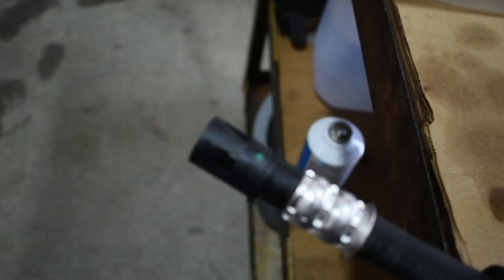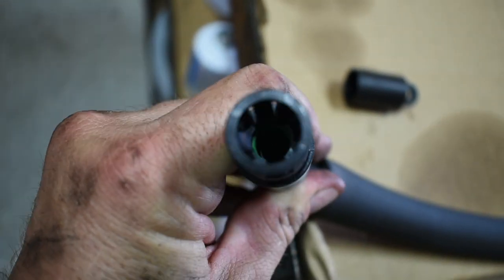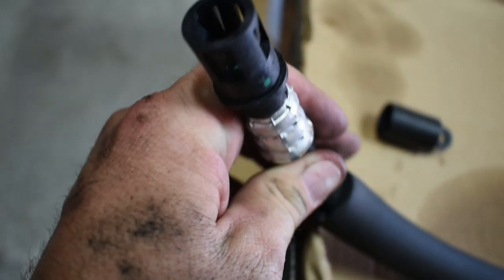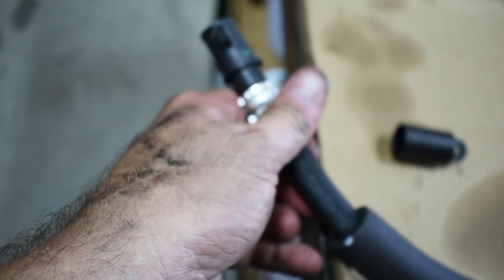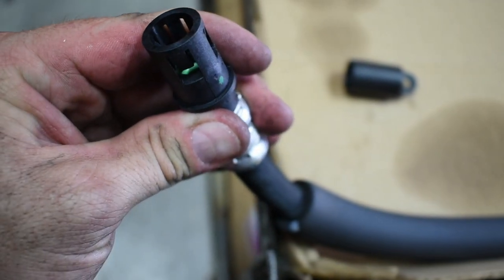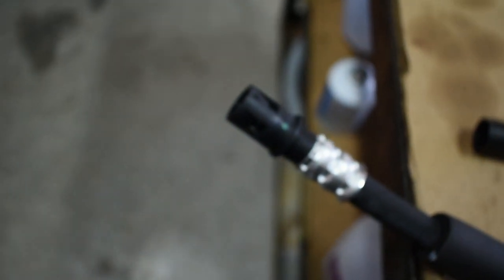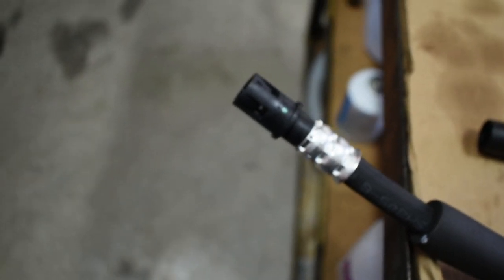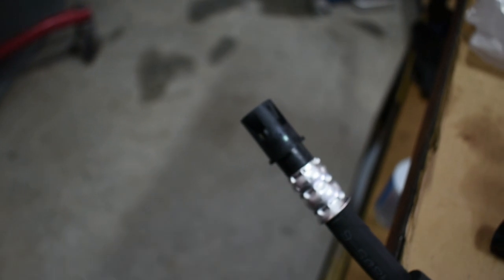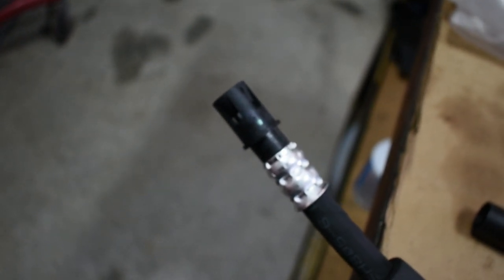The spot I want to show you here — you can see it's got four tangs in there, one, two, three, four. Each one of those is pushed inwards, so as they go past a flange on the pipe, that locks it in and keeps it from letting go. You have to have a special tool typically to get these out. But because we have a new part, I can actually just get in here with a screwdriver, pry these back, and even break them if I want to — because I'm not going to be reusing it. When you actually have a new part, it makes this job a lot easier. But if you're going to be pulling this off to do some repairs, do go buy some quick connect releases — they sell them in a lot of different stores and they're not terribly expensive.